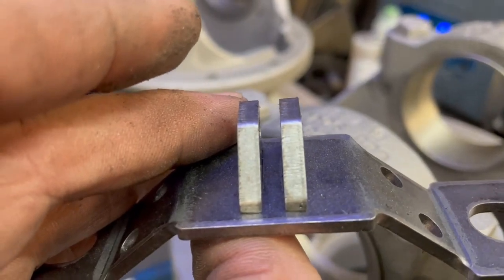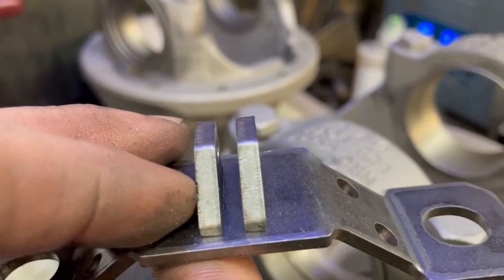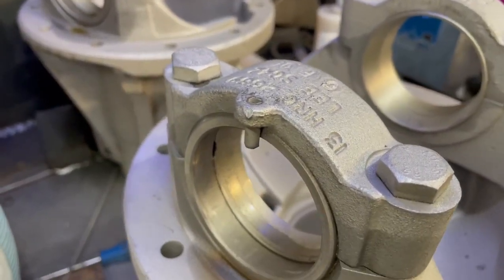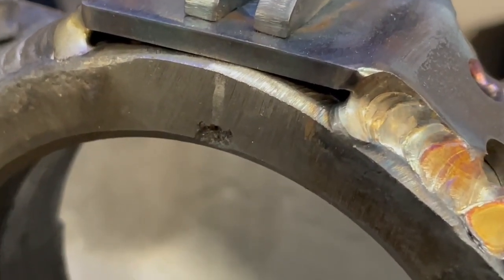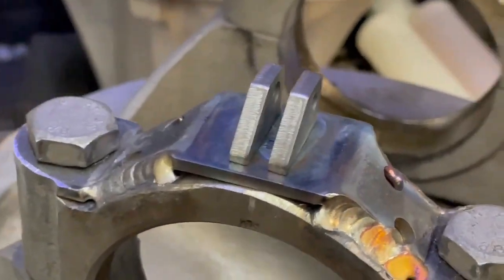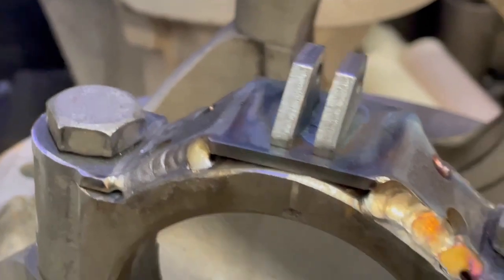That's 4mm Domex, so that's like having 12mm each side. We don't even put a cotter pin through — we put a 5mm 12.9 grade bolt with a nut on the end. That's where the silly pin used to be on the side, and we now have our Domex carrier cap conversion welded on.